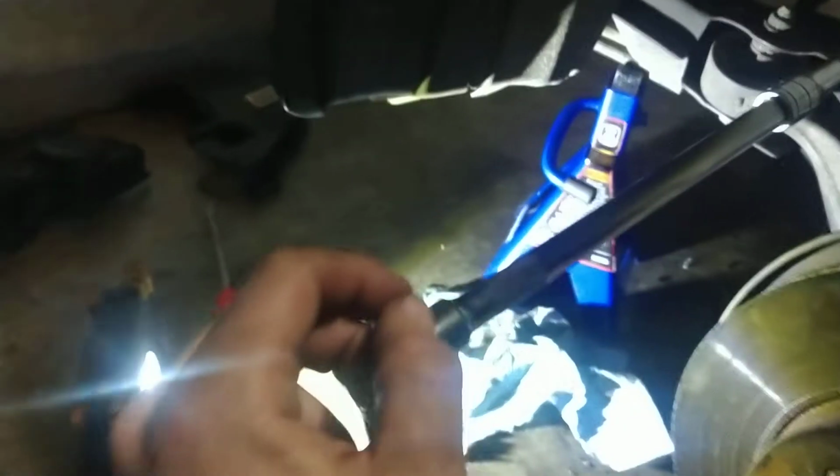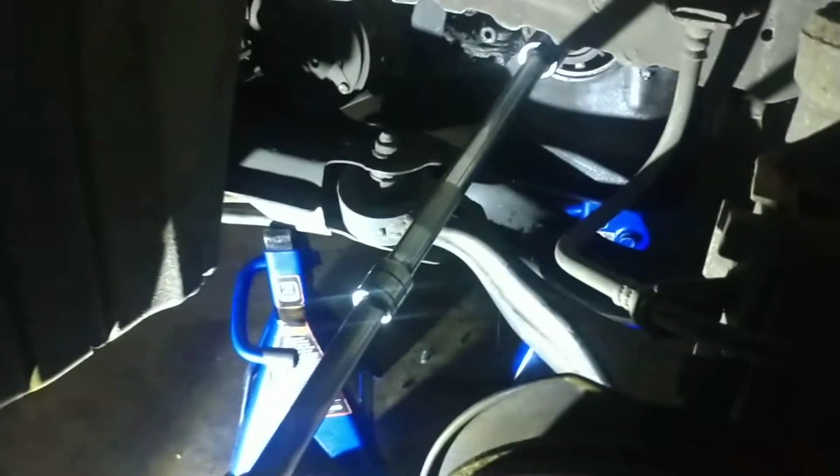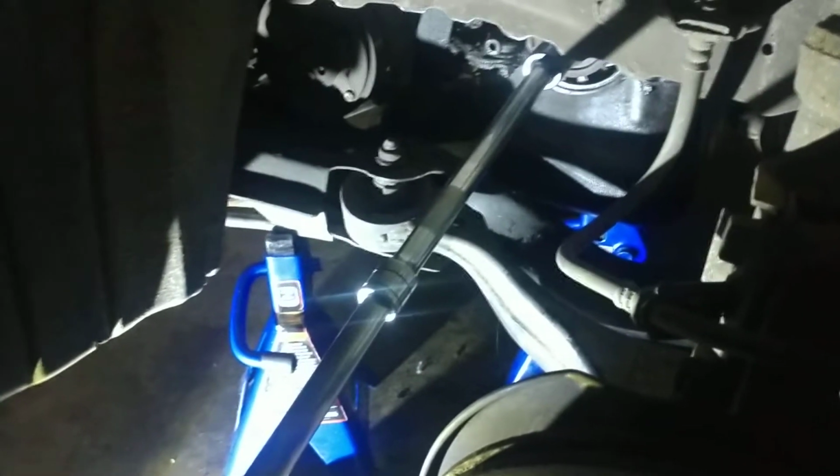Makes it really easy. I just stuck a breaker bar on the damper holding tool, stuck it against the ground so it couldn't rotate. I took my two 9-inch extensions and grabbed my other 18-inch breaker bar, and then used a 5-foot steel pole. Lots of leverage. And I set both those on my jack stand right here, so there wasn't any ability for it to slip out downwards. And then I just wrenched on it until it came free. That took about 30 seconds or so after all that, but I'd already spent at least 15-20 minutes cranking on it with other tools.